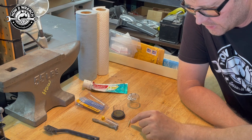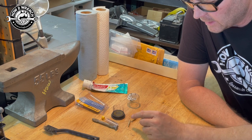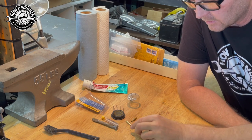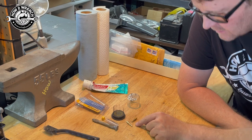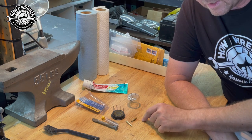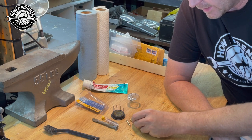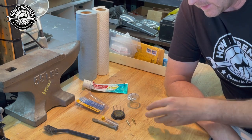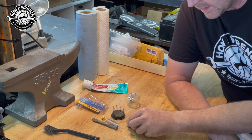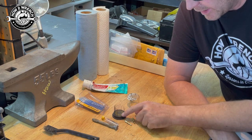People will argue, 'Oh, you're changing the size of the jet.' Yeah, if you go in with the largest one first and ram through there, you'll clear it but make it too big. It's really important to understand that these are precise metering devices. It's always best when possible to use a new OEM jet. I never use the cheap Chinese or Taiwan replacement jet kits — I'll use bowl gaskets and float needles out of those, but I always stick to OEM jets whenever possible.